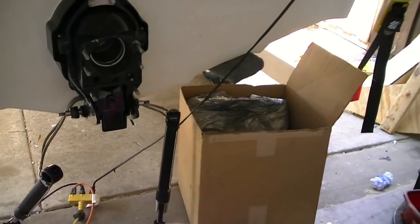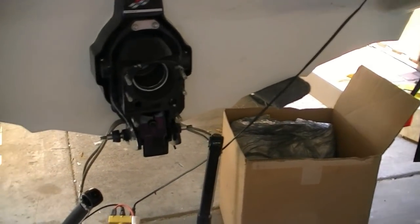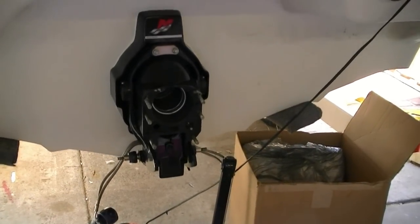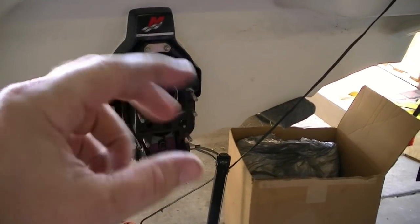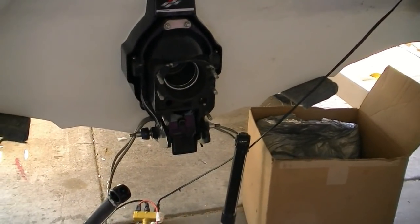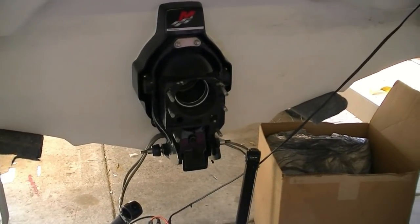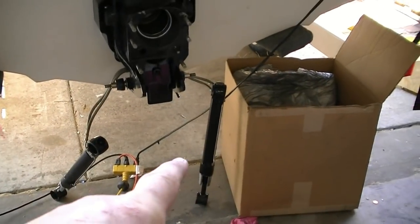And we made it go all the way out, all the way in, all the way out. Probably did that 4 or 5 times to make sure all the air's out of it. And it kind of turns the oil into a foam. It's kind of a gross mixture, but it eventually goes out like a little root beer float. All the foam bubbles come out and it's nice clear motor oil. So these things are bled out.